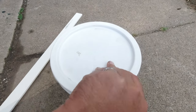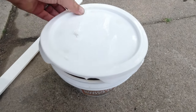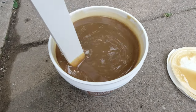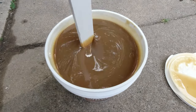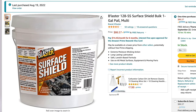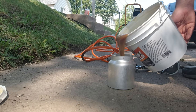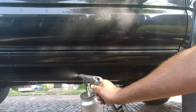As for undercoating, I'm using a newer product called Surface Shield. It's similar to fluid film and wool wax, but it claims to last twice as long. From the research I've done and experiments I've watched comparing the three, Surface Shield is the best. It comes in spray cans, or you can buy a gallon and use it in an undercoating gun. Since I just purchased the undercoating gun to spray the rust cutter, I decided on the gallon so I could really coat this bad boy up. I sprayed it in every nook and cranny and also used the hose attachment for the inside of the frame.